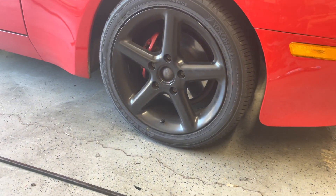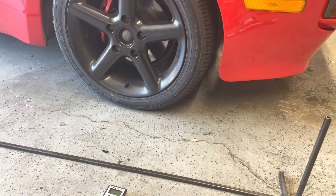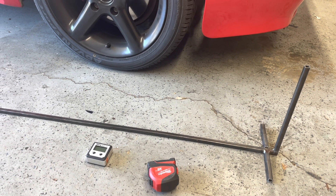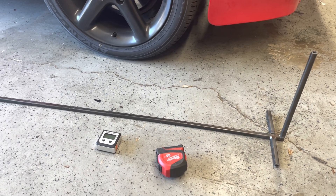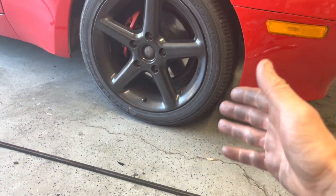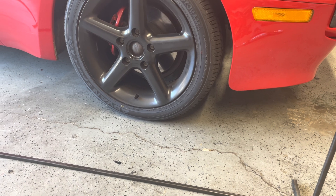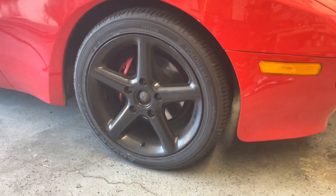But I've got this Porsche 944. I did a manual steering rack conversion and now I want to set the toe. I didn't change caster or camber, but I put a whole new steering rack in with new tie rod ends. I want to set 1/16th of an inch of toe-in. Zero toe is best for tire wear, but a little toe-in helps prevent wandering and improves steering feel.